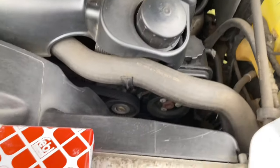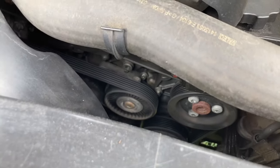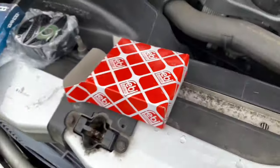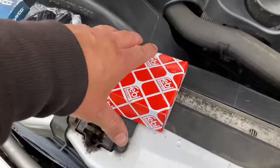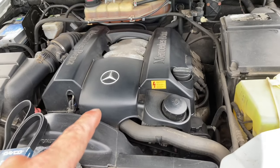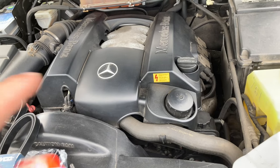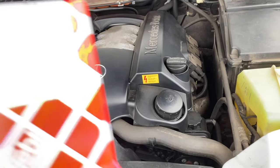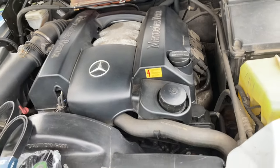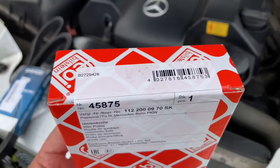I have the parts here. I'm not one to be beaten. There's nothing wrong with the tensioner — the belt is perfectly tensioned, it's just the bearings have gone in that pulley. I did some research and measured it, and here I managed to find a part. If you give your reg, this part will not be listed — proper original equipment. There's the number if anybody has one of these. I would imagine this would be the same for the ML 350, the 320 — the 3.7 V6 petrol and the 3.2 — not the diesels or V8 ones like the ML 430s.